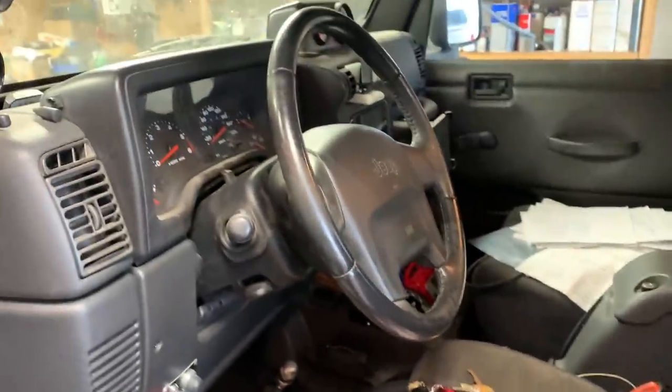Alright, time to shut her down — I've pissed around with this too long already. Motherfucking beer time — I am baffled but the gears have been turning. Using the Novak emulator: can work, then not work. Using HP Tuners: can work, not work. That kind of leads me to believe the issue could be on the Jeep end. Went through and checked my wires for the cam and crank back to the computer — they tested all good. Tested the grounds. But for some reason, something must be off somewhere — because I am mind blown. I don't know what the fuck is going on. I've been troubleshooting everything with still no luck.